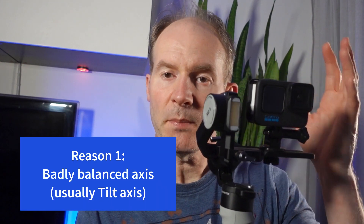I find that perhaps the most common reason why it's not being balanced is the tilt axis, because you could find that you've balanced it in the tilt axis and everything's fine, and it's also balanced in all the other axes, but one of the things that's easy to forget is that we also need to balance it by holding the gimbal like this to stop it from spinning down. I actually have a comprehensive video on how to balance the GoPro and the Crane M2S, and it's very easy when you're out and about to accidentally forget to do this. I find that is one of the main reasons why that axis lock error can occur, so take a pause and do the balancing properly following the instructions in my video, and that will solve one of the reasons for the message.